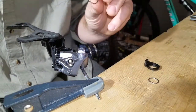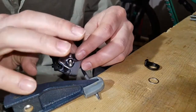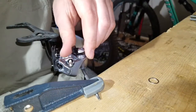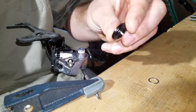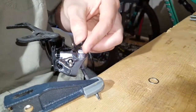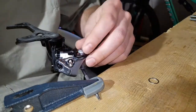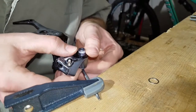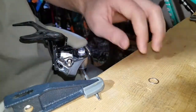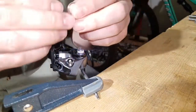Take your wave washer that's included in the kit — that goes next. It goes in this little groove. And then your B tension plate goes with the convex side down into the concave little space. You should be able to press down and feel some spring, and that's what will ultimately allow us to put the split ring in.